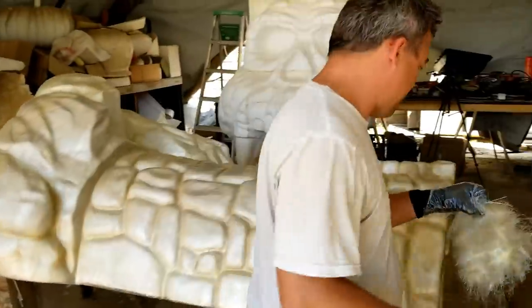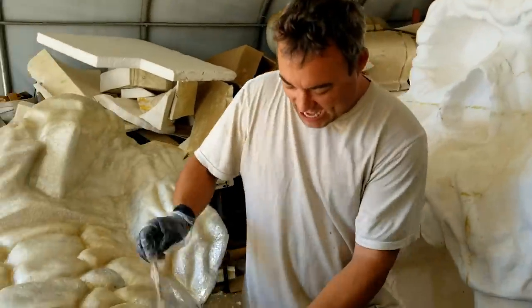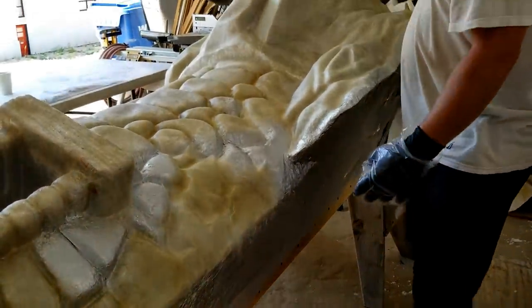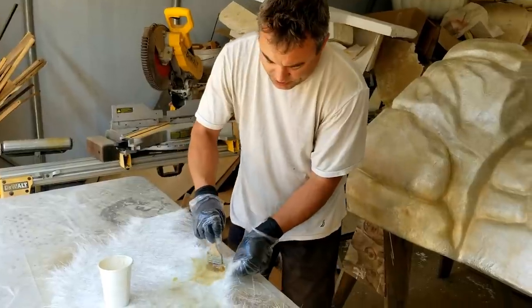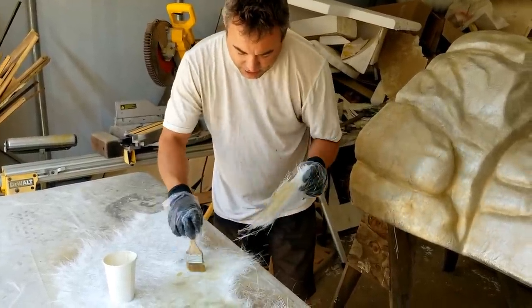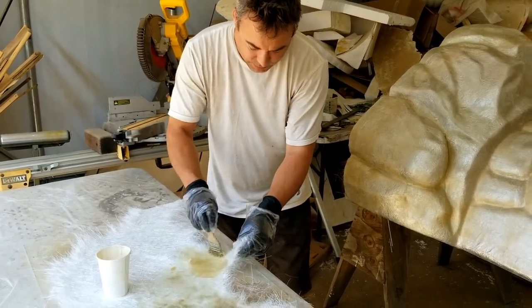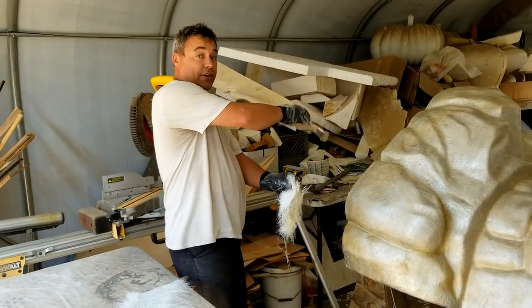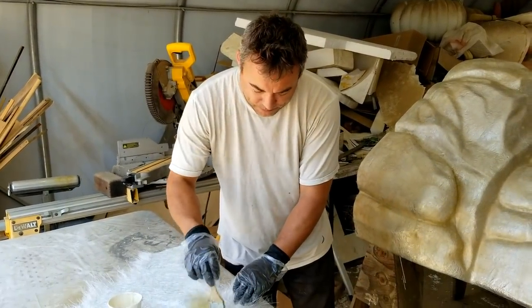Okay, and because it's a straight section, you figure you can handle the bigness of the... I can do big sections right here. Nice. All along here and on the bottom. Cool. Plus, this is that thicker 3-ounce piece, so it takes a little bit more resin to soak through. So what, are you just going to dump a cup on there? Yeah, well, for this one, I'll wet out the bottom. Okay. And that way it sticks on there. Get it nice and juicy.